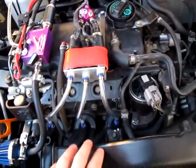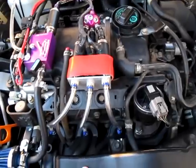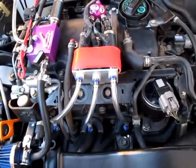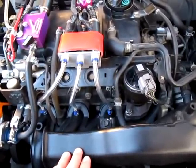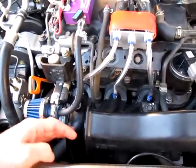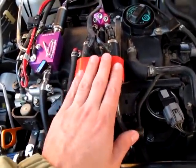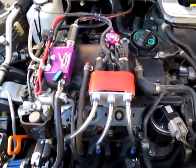And if you want to understand how vacuum is maintained, like I was saying earlier, just read up on Venturi nozzles. There's theory behind how it works, because when you're at wide open throttle, the vacuum in the intake manifold is very low, but because there's airflow coming past the Venturi nozzles, that creates the vacuum, that maintains the vacuum signal, as AquaTune says. So that's basically the way the system works.